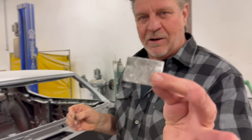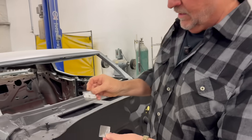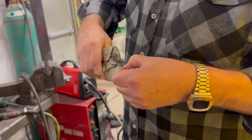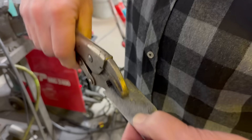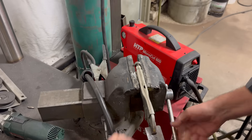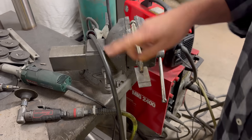There's a hole in here — about a quarter inch, a little bit over a quarter inch — just like we would do when repairing a car. Then you've got a piece of flat stock underneath. I've already prepped up some of the other pieces, but I thought it was important that you saw what a plug weld actually is. Same gauge material, just like the car. Let's go weld it. We'll clamp those together, set it up, fire up the welder, and throw that weld on it.